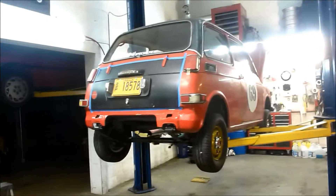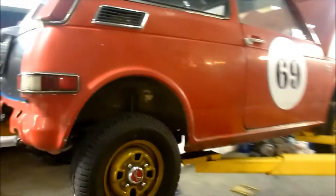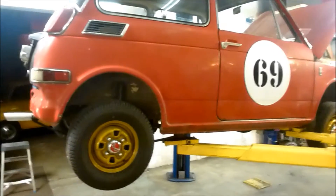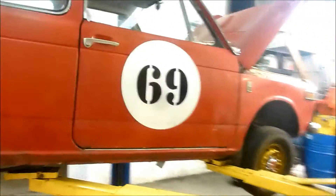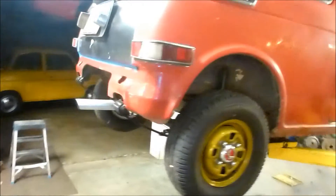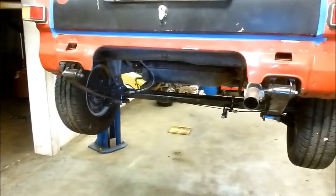I think the diaphragms went bad — they are available. Parts are available for both the hydraulic part of the power booster and the vacuum part. However, I penciled it out and it was like $700, so I went back to manual brakes. However, the car is biased heavily on the front due to the disc brakes and the power brake booster just being on the front.